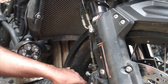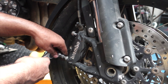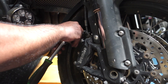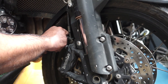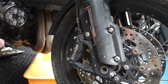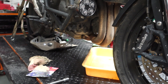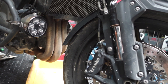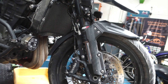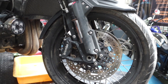Let me tell you a bit about these brake pads. The compound is made out of copper alloy, which also ensures that this has minimal brake dust. The fact that you would use a sintered double H brake pad — a good thing here is these brake pads would cost as much as OEM pads, and yet they would seem like an upgrade even though the cost is the same. Because it has such a good bite and good feedback, it automatically makes you feel that you have better brakes. The brake pads take about 100 to 250 kilometres to settle in properly, and then the magic really begins to show.